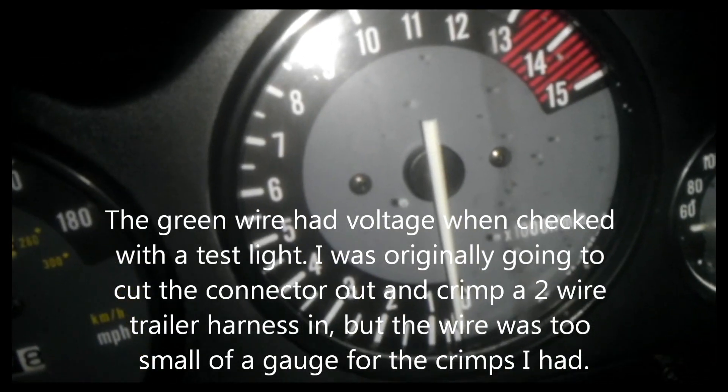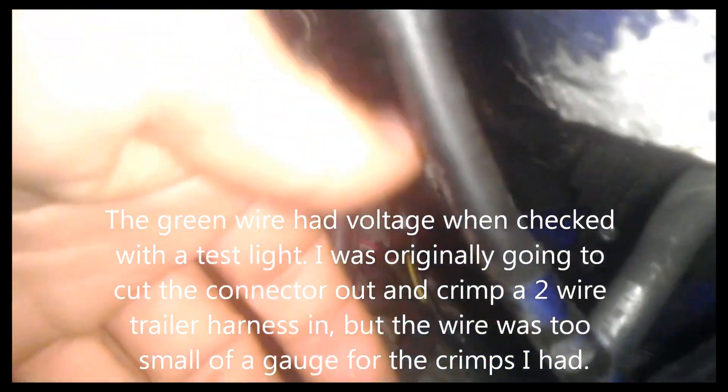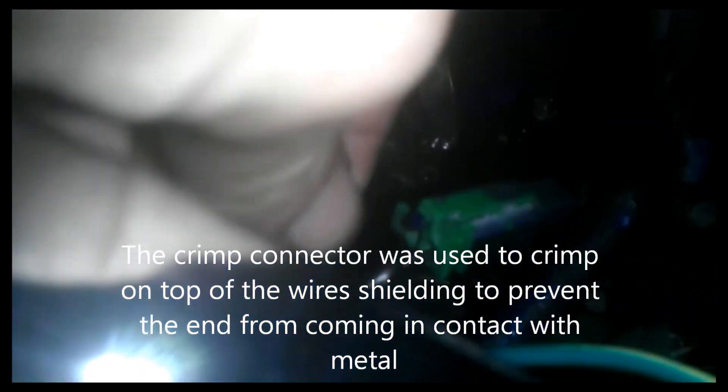What that's telling you is that there's a wire here that goes to the fuel sending unit, and mine's broke off. That's what this green wire was to. So what I've done is I've made a splice wire that I'm going to bypass this connector and go to the other side. That way I have the green wire with continuity, which will take away this code.